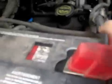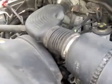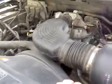I hope that helps. Try to give your mechanic as much information as you can. And, as always, open your hood periodically yourself. Even if you're not mechanically inclined, you ought to be able to find something like that corrosion under my battery terminal. If you quickly glanced at my battery terminal here, you'd say it's clean, it looks fine — they usually have a cover over it, because if you touch that with a ring, you'll lose a large portion of your skin. Don't wear anything metallic when you're messing with a battery. That corrosion will leave you stranded — we get more cars towed in for a loose or dirty battery cable than anything else. So save yourself from being late for work or stranded at night. Tell your oil change guy to check that. Have a great day!